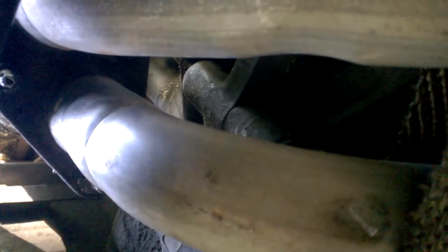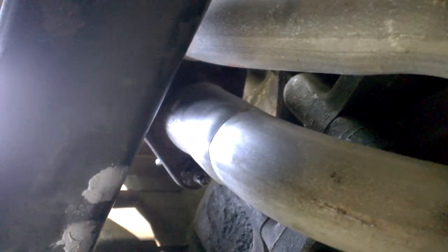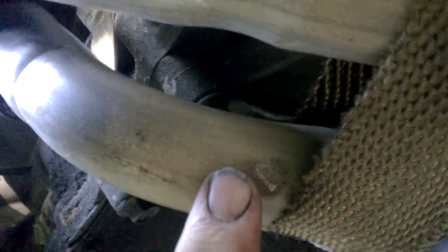So I mentioned balance. Crawl under the car — I left the heat wrap off because I just installed a manifold that's wrapped, and there's one bolt that while it's wrapped up I cannot get to, so I had to unravel it. As you can see, I've got two pipes coming off my engine into a single pipe. The reason for this is your exhaust velocity is going to be different in each of those tubes. The faster-flowing tube, when it's traveling in its waves down into the single pipe, creates a small amount of vacuum for the slower-moving tube — just like the scavenging effect on the cylinders, allowing that exhaust to be scavenged out of the manifold much quicker.